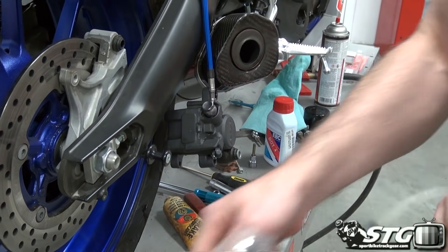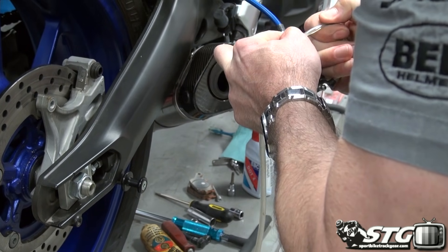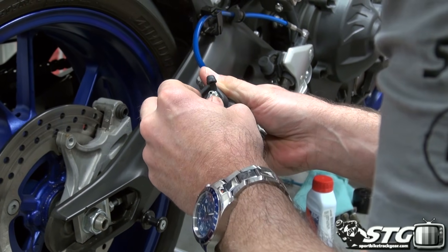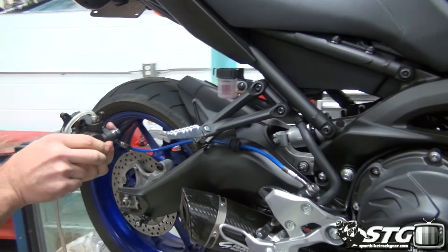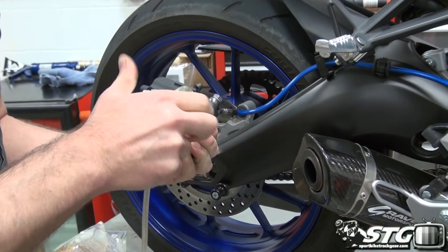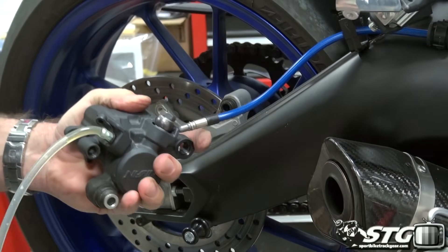Now this cool speed bleeder bag and hose kit — I'm going to move the plug from the end of it. You can reuse this thing over and over again; I think they're about $10 and you can find them on the website. It makes brake service so much easier and cleaner. I already broke the screw loose previously, so I'm going to open it — that will allow me to get in here and push that piston back by hand. A little fluid running there, not a whole lot, since the pads didn't need to move back very far because they were in pretty good shape.